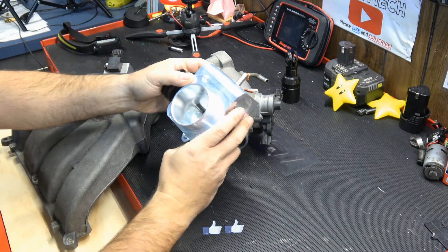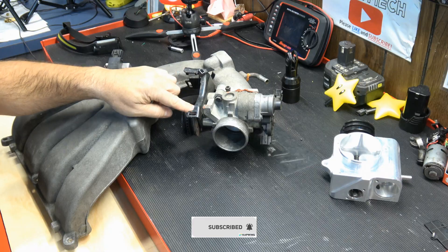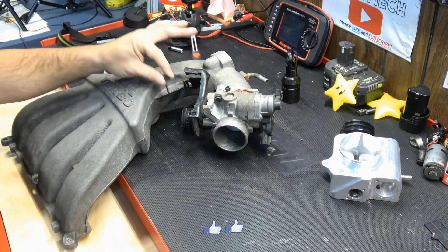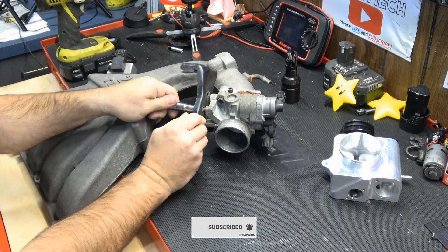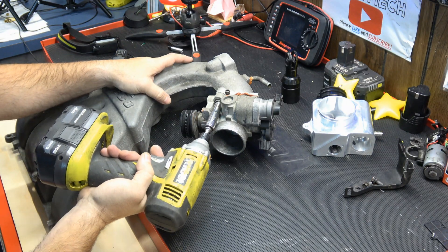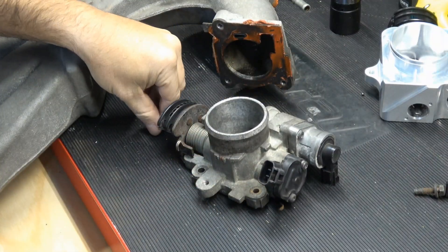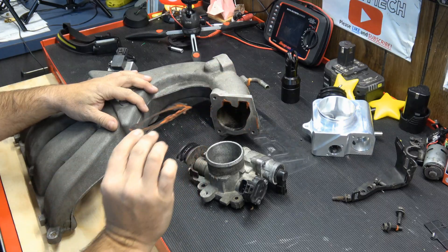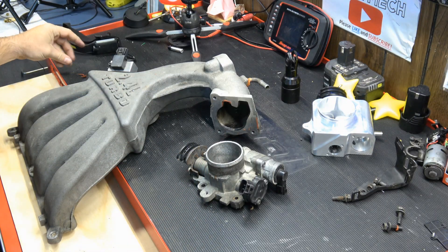This is really well made from Modern Performance — nice billet piece of aluminum. The first thing we're going to do is take this bracket off here, housing the throttle cable mount. Keep track of those bolts. Then we're going to take off these main 10 mils here. Remove this old gasket — the new one came with the gasket. I'm going to clean up any of this RTV that's still around.